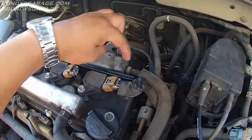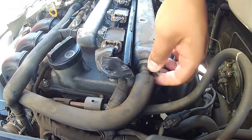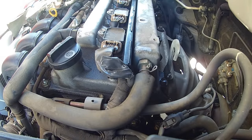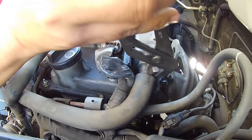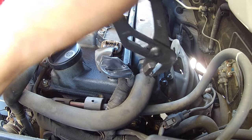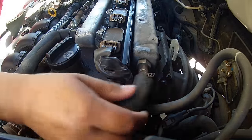What we're going to be doing today is replacing the PCV valve — the positive crankcase ventilation valve. The PCV valve is right here; that part right there is the PCV valve. Right here you have this pin clip. Get a pair of pliers, push that out of the way, squeeze it together, get it out of the way. We're going to work this hose back and forth and get this thing off.